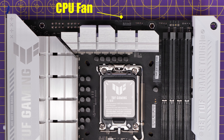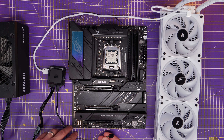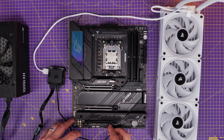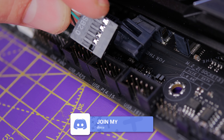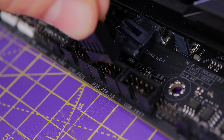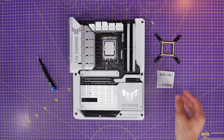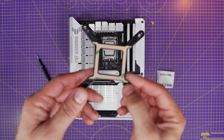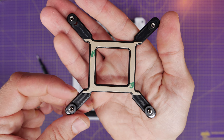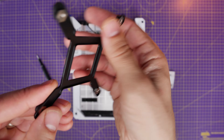The basic wiring is: connect up to your motherboard to the CPU fan header, to the power supply unit, and then to the USB connection as well. You can see the CPU fan connector at the top of the BTF motherboard — that's where it will be located on most motherboards. The USB connection at the bottom is really important to plug in, otherwise iCue won't be able to see it and you won't be able to control the devices.